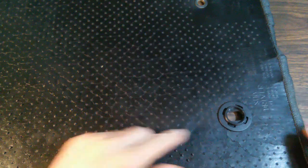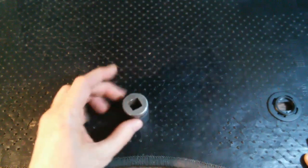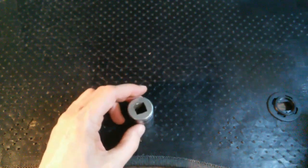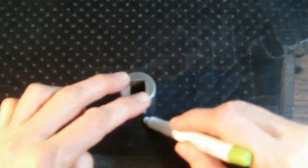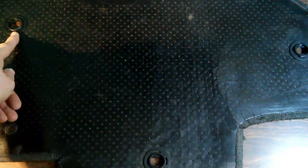After marking the three centimeter circle, it occurred to me there must be an easier way to do it — how about just using a socket? This is a 23-millimeter socket, and it will make a three centimeter circle if you take your marking pen and go around it. So much easier. I've gone ahead and put in a couple more of these fittings — here's the first one, here's another, and here's another. That's on the underside, and now the top side: one, two, and three. We're going to try it out in the car.